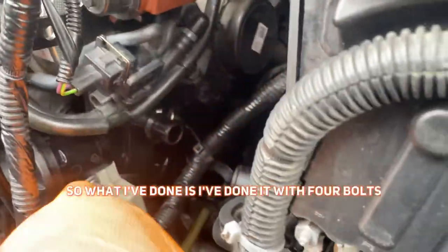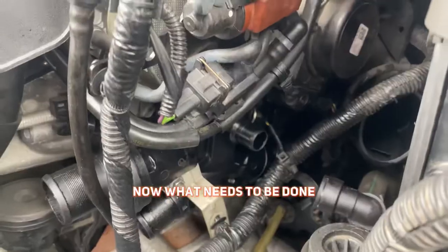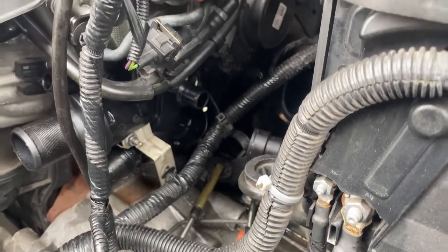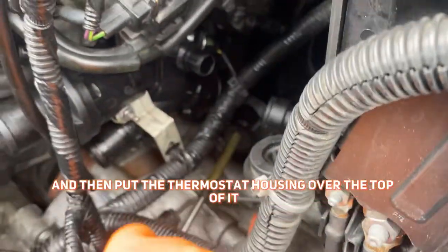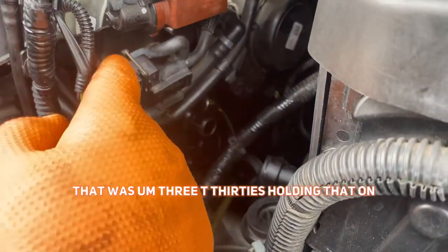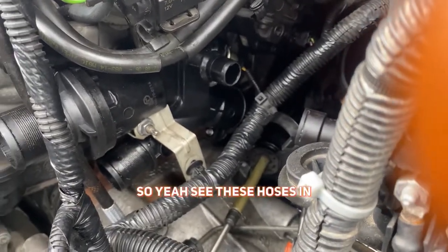Okay, so it's back on. What I've done is secured it with four bolts holding it on and the one bolt back here holding the back hose on, and I've put the electrical connector in. I found that I didn't want to put these studs in blind, so I wanted to put them in and then place the thermostat housing over the top — but this bracket was in the way. So I pulled that bracket up out of the way; that was three T30s holding it on, which gave me space to slide the bracket over the top of the threads.